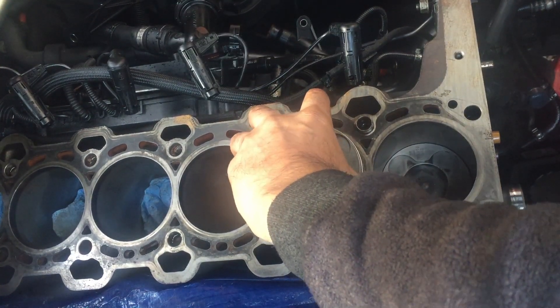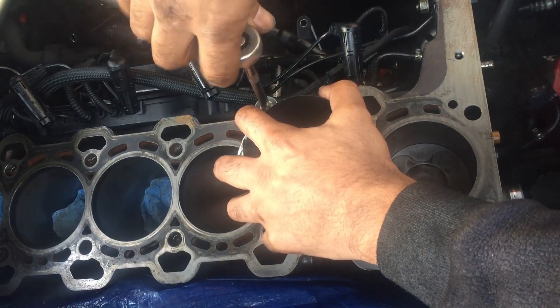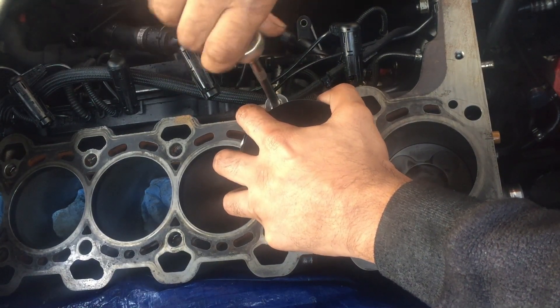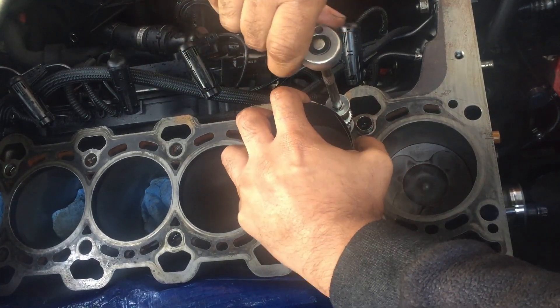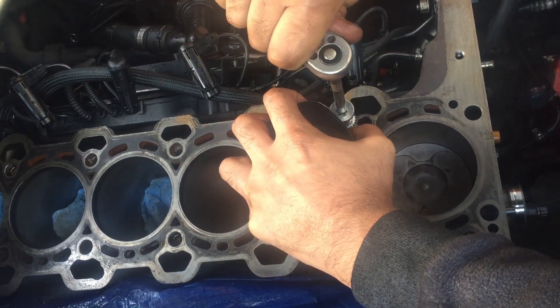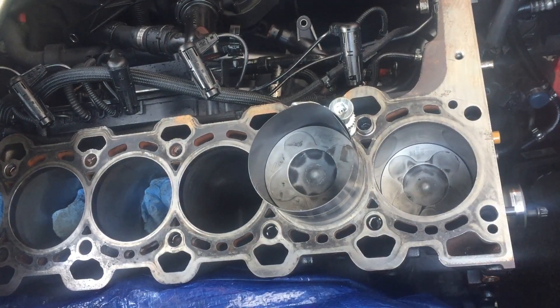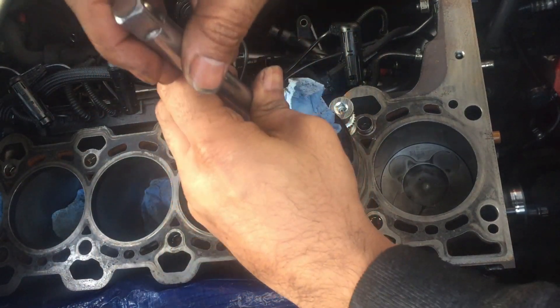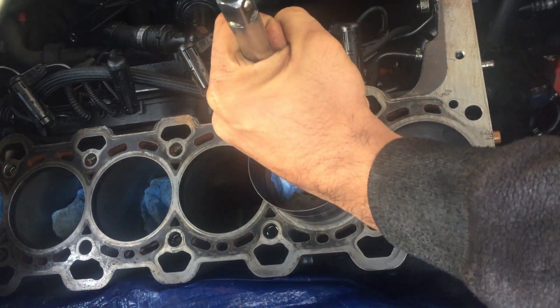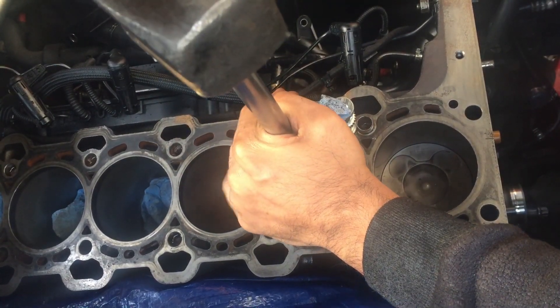Start the piston off, place the tool over the piston. That's nice and tight — make sure it's flat as well. People may not agree with my method, but I'll be using just tissue. Extension and a hammer — keep it flat to stop tapping.